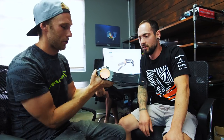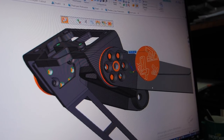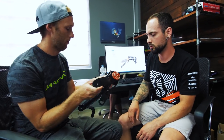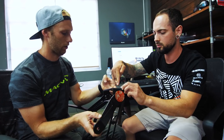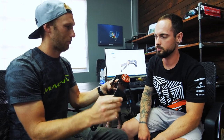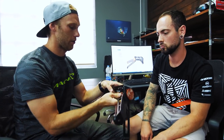Okay, back to the topic. This is our adjustable sub cage for the 2017 and newer Duke 125 and 390. It's a plug-and-play system — you use the stock screws for the main mount and the exhaust holder. You just take the stock one off and put this one on, so it's about 30 minutes of work.